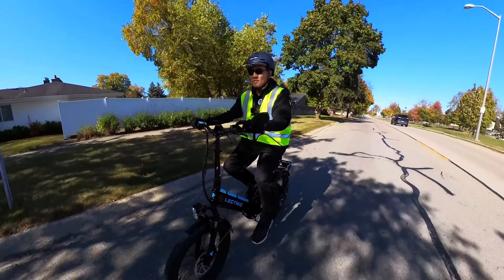As we get toward the hill test — many of you who've been watching the Russ Is Right channel know what we do — we get to this area by the bridge, stop there, then throttle only to get up the hill and watch the speedometer to see what kind of speed we're getting. Based on the torque rating, I don't expect this to be the fastest climber, but I'm sure it'll be fully capable. So far I haven't noticed much if any ghost pedaling as I approach the 20 mph range, and I've been in gear seven most of the time.